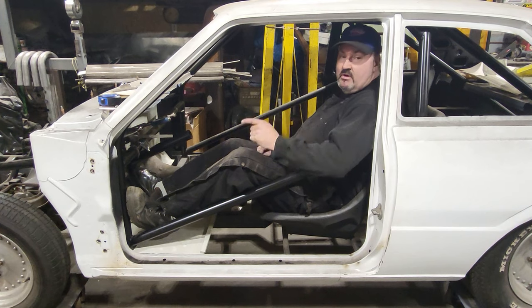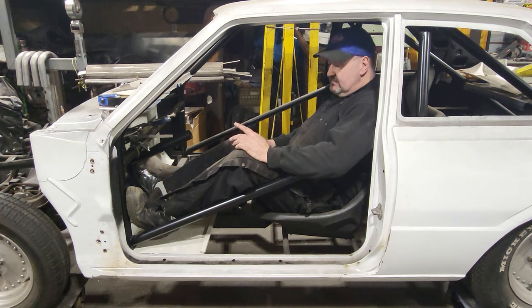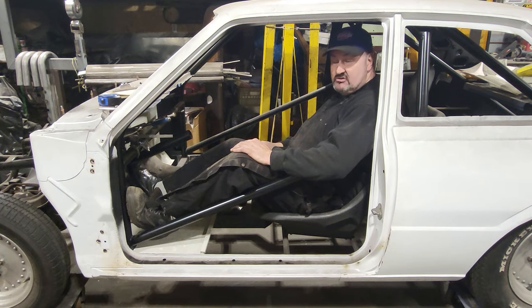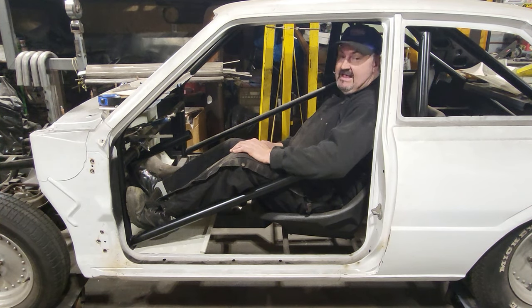This one here is a quick one. A lot of you guys pointed out the issues that I'm going to have with this brake system. I said I had a 4-to-1 system in this car, brake ratio wise. When I came to really check it and really look at it, it was a 3.71 ratio in this front brake pedal. That had to be fixed.